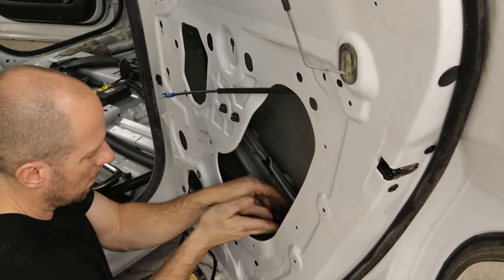Now we can put our seatbelt in on the passenger side since all of our foam is dry. Bolt that in, then route the seatbelt up the B-pillar. A lot of people complain about the foam because it causes rust, but this is actually a different kind of foam — it doesn't really hold water quite like the foam that goes in quarter panels that notoriously rots them out. Looking at you: Yukons, Tahoes, Escalades, any Dodge product, Tauruses, Escapes. No manufacturer is immune to the foam.